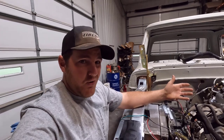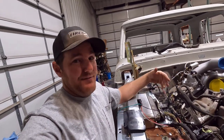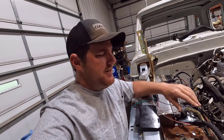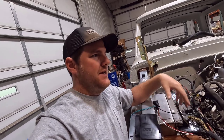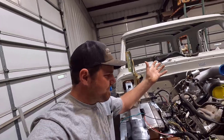This is kind of the boring part — I like it, but cutting wires doesn't look like you did a lot. This has been like three or four days of work, so it's time-consuming and tedious. I like getting it all sorted out where it needs to go and making everything happy. I like the feeling of accomplishment once you get all the wiring done. Once I get it all exactly where I want it with all the lengths just right, I'm going to pull the whole harness out, wrap it with wire loom, and put heat shrink on the ends — really clean it up so it's not a big mess of wires under the hood.